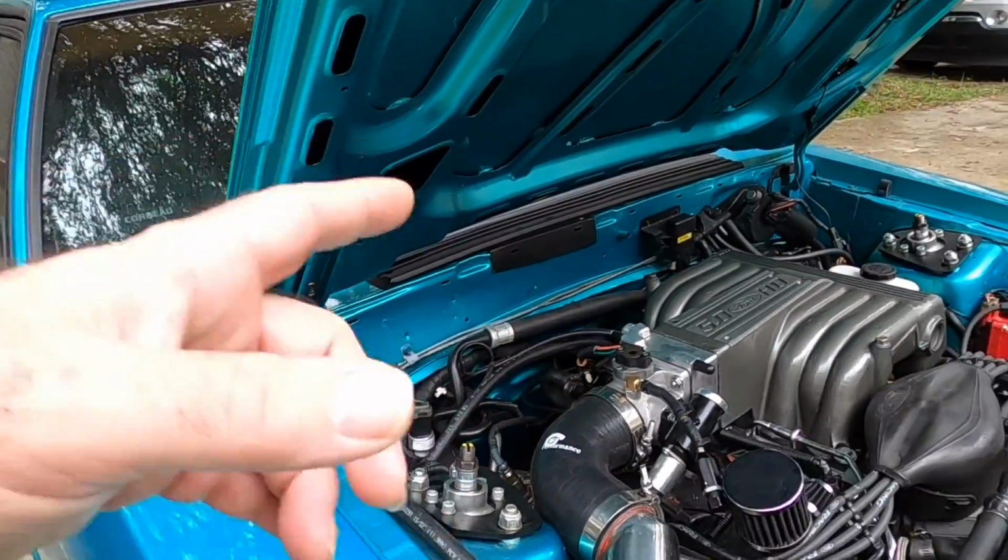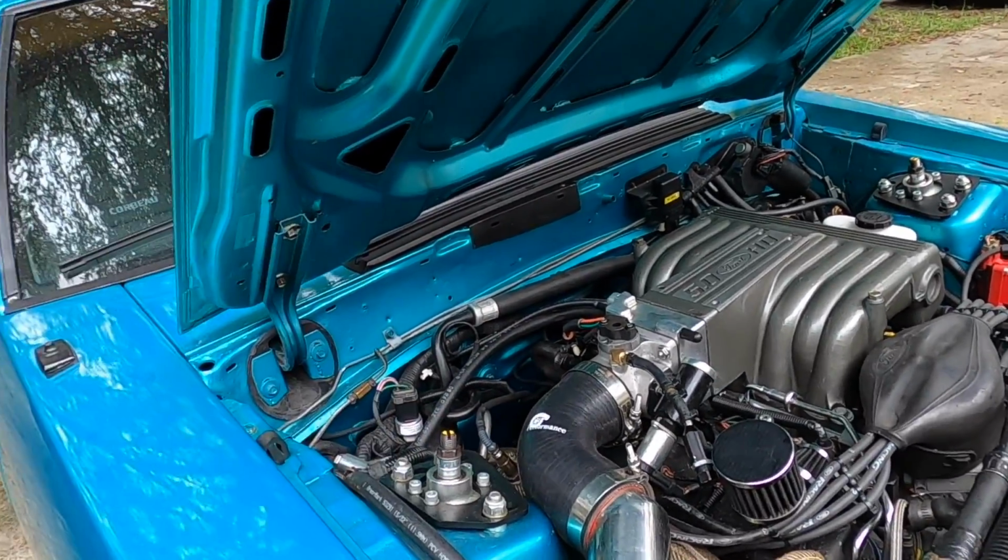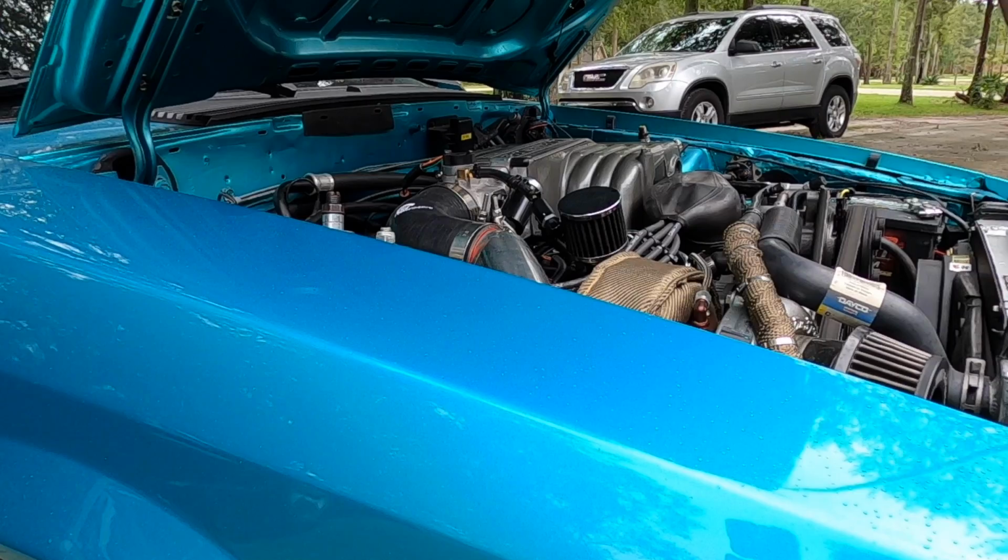Well, for air conditioning, power steering, headlights, windshield wipers, all of this stuff matters. An electrical load on the car can actually pull it down to where it needs to idle up a little bit. Crazy, right? So real quick, I want to talk to you guys about how to diagnose whether it's an idle air control issue.